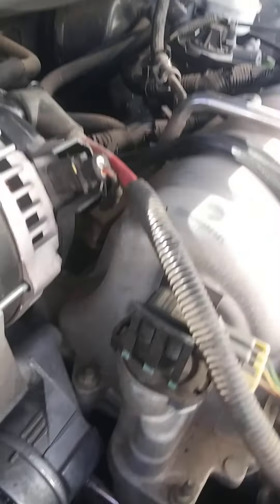Line up the elbows in the same orientation they were in and push the assembly back on. This side goes into the block, this side goes into the water pump. Once you get those elbows popped in, put in the first bolt right here — that holds everything in place and pulls it to where it needs to be. Then put in the rest of the bolts. Put your alternator back on: put this bolt in here, the other bolt there, and leave them all loose so they all go in the holes, then tighten everything up. Tighten this bar, put the nut back on, put the 10 millimeter back on, put your harness on.